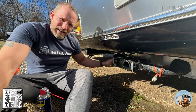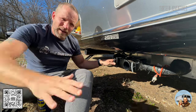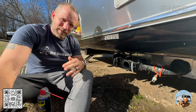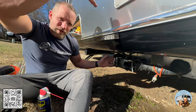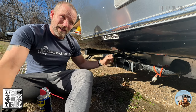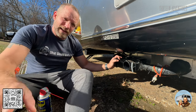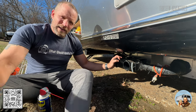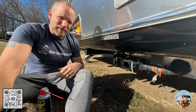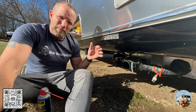Once I have drained the black tank completely and I see nothing else coming out of the other end of the hose, I turn on my flush. Step one: pull the black tank, let it drain until nothing comes out. Step two: run fresh water into the black tank flush until I see clear water coming out. Then I close the valve and go inside to watch the gauge and get the tank up to about 80 percent. Once at 80 percent, cut the water off, let it sit about five minutes, then open the valve again and let it all rush out. Then I put five to ten percent water back in and add my tank treatments.